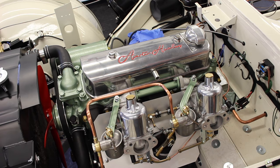Now then, we've had a little listen and we think that we are too weak. Irregular note and splashy misfire, because the miss is inconsistent. It might be miss and then miss, it's not miss, miss. So I would say we are too weak, so we'll use that as our baseline.